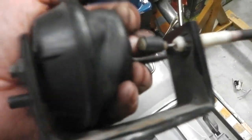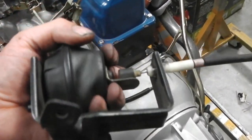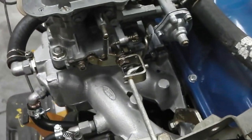Okay, let's keep moving. Just between jobs, guys, I'm testing out the cruise control. I've got it mocked up here, just fitted this. This was the next job I was looking for. There's the bellows. They work off atmospheric pressure, so when the vac pump draws out of there, atmospheric pressure squashes this. You'd think it's the vac pump that's pulling it, but it's not. It's the fact that atmospheric pressure can collapse that down, and you wouldn't think this is powerful enough to actually activate the wide open throttle of the car, but it will do it.